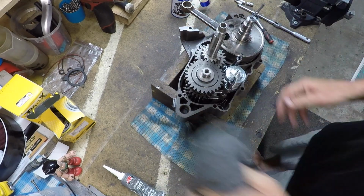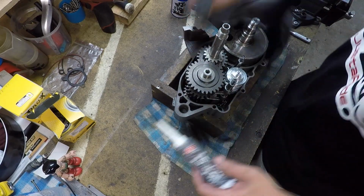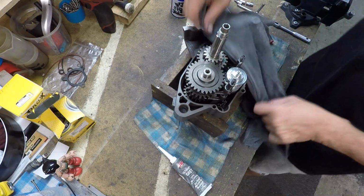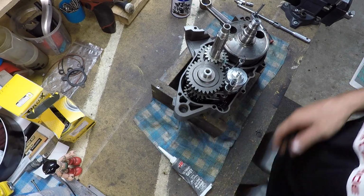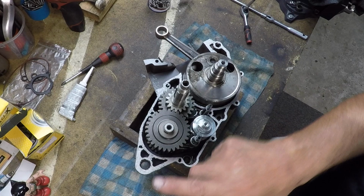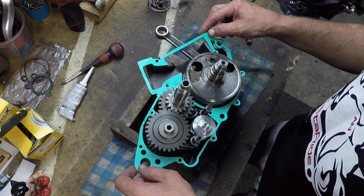So now I'm going to clean this gasket area because I'm going to apply some JB Weld sealant in and around the gasket area, much like the water pump that I did earlier. Okay, a lovely dabbed on surface area there, just to maximise surface tension. Like I said before, don't smear, dab.